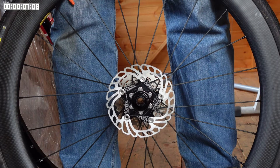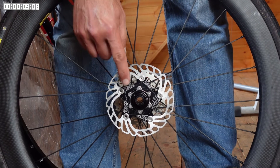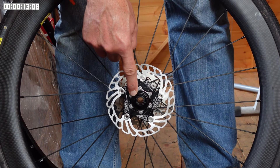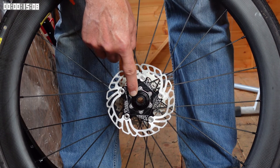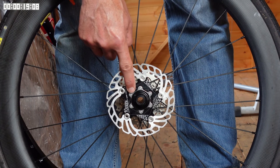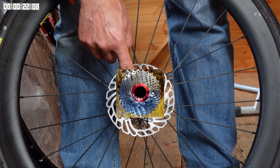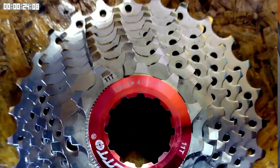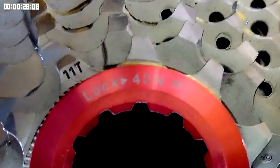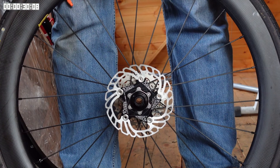In the top right-hand corner there's a link to an earlier video. In that earlier video I suggested you should torque the center lock brake lock ring up to 4 Newton meters — that advice was wrong. The torque you should use is often marked on the lock ring, normally around about 40 Newton meters.